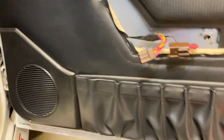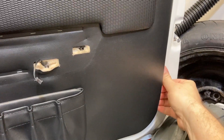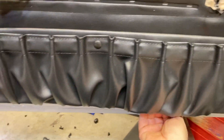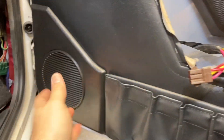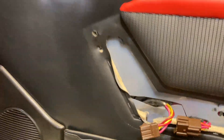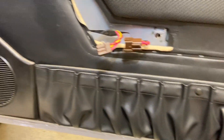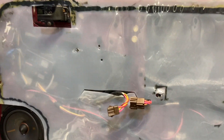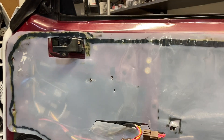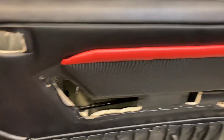Next, pull away the Christmas tree clips off the back of the panel — that's usually pretty easy. Some will get stuck in the door, some will stay in the door panel. If any are fighting you, feel free to use a trim tool to help pry them out. I've had mine on and off several times so it's pretty easy. I just ordered a new package of clips to replace a few so they don't pop out when you don't want them to. Just like that, the door panel — you lift up a little bit and move it forward towards the door hinges to get it around your handle, and it pops right out.